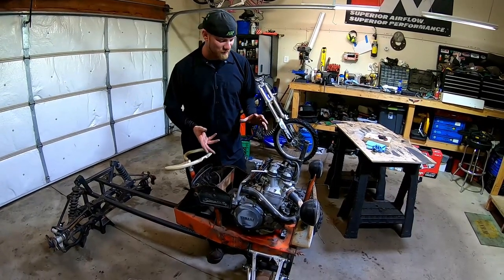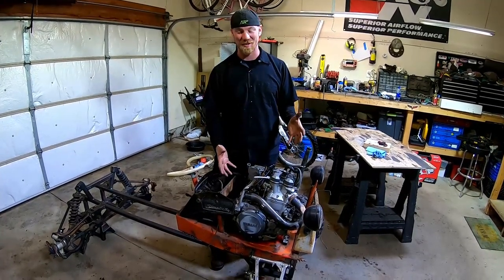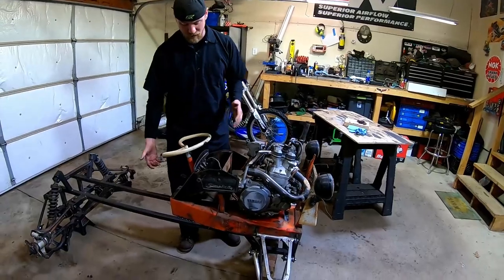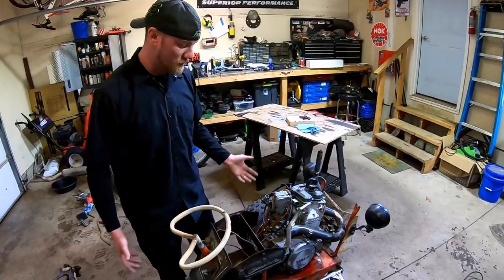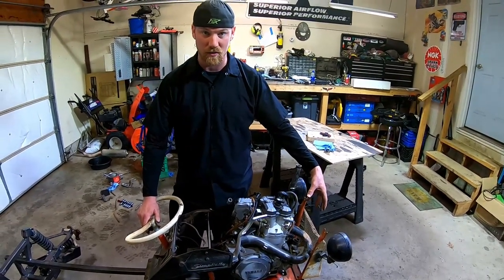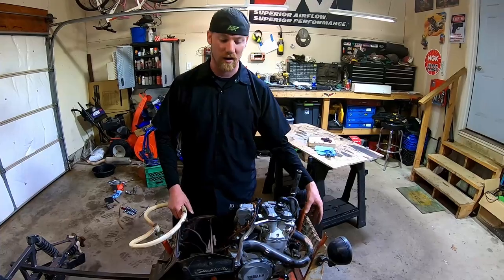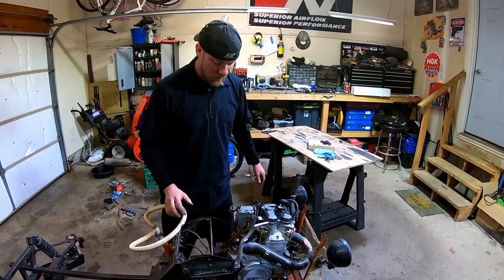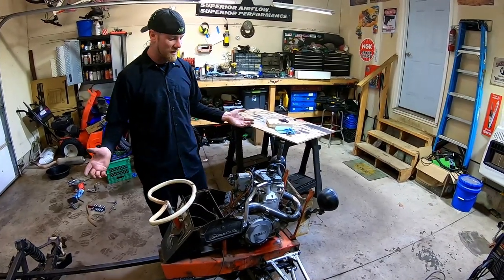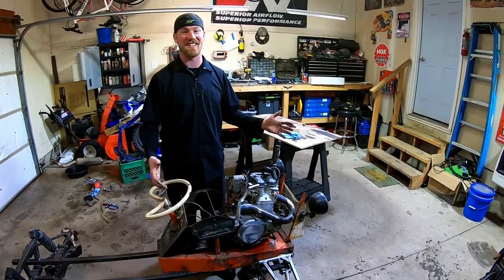We're going to have to figure out where everything's going to end up. We just wanted to see what it's going to look like in here — it looks really cool. With the dashboard and with the hood mounts back here, we may have to bring it up some, move it back some. We need to find a placement for radiators and an oil tank — as we talked about, this has a dry sump so we'll have an external oil reservoir. The engine only holds a couple ounces of oil on it. Sorting out the exhaust and the kickstarter — all that stuff's going to be kind of fun and interesting as we go along and we'll definitely show you guys everything.